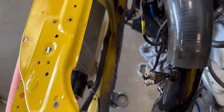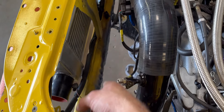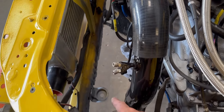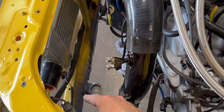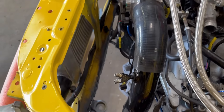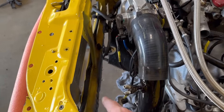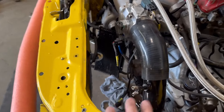I was cutting the lower part of the radiator support off so I could weld the radiator mounts on there. Because of how I had to cut it, I had to stitch weld the whole bottom of the radiator support back together — it was separated — but it fits in there really well now. I'll probably clean it up later when I pull the engine back out to paint the bay.